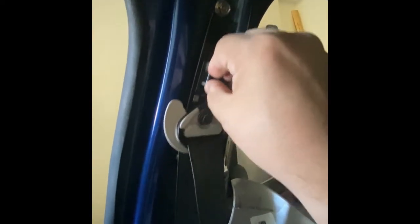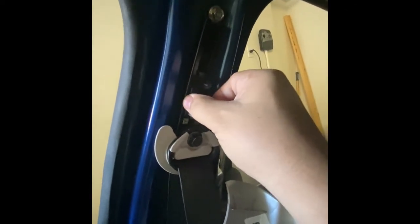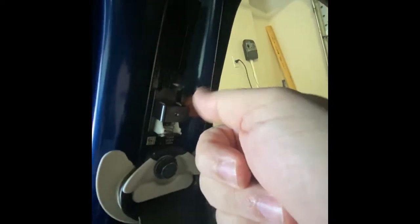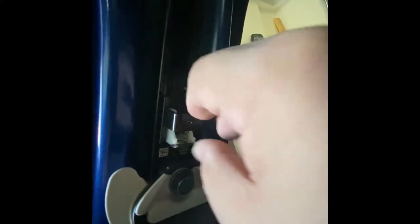So here's the issue really — this part here is what slides up and down, and because there's a little bit of play there, that is what's making the rattling sound. So what we're going to do is put the zip tie underneath the rail and route it right through this little post here. As you can see, there's a lot of play there.